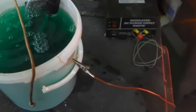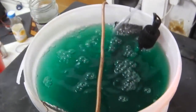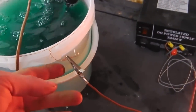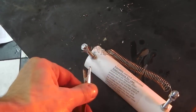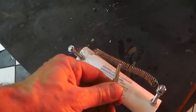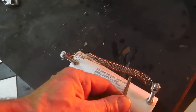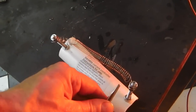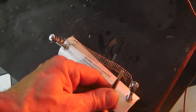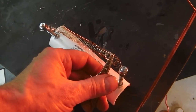So we've got the power feed set up now, 12 volt power pack. Negative connection goes on that bus bar. You're going to hang stuff on copper wire off that. Positive connection comes from the current controller. You'll be picking the right electrical voltage that you want to use. So I'm going to go for a small item. I'm going to be down this end if the input's at the left. I'll be picking up down there, which will be a lot less power because it's going through that resistance. So I'm going to be hooking up round there like that.